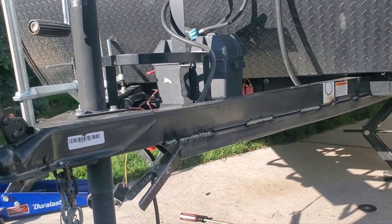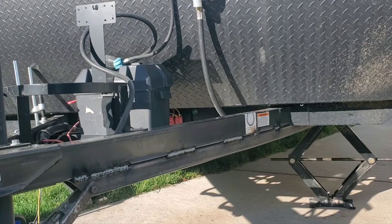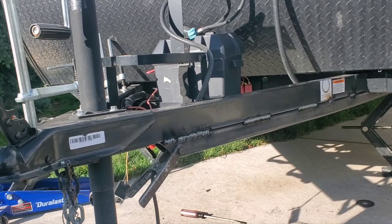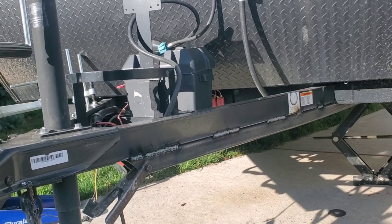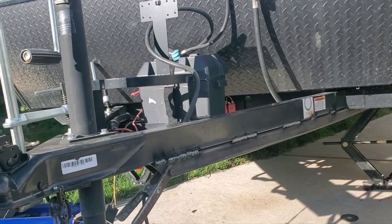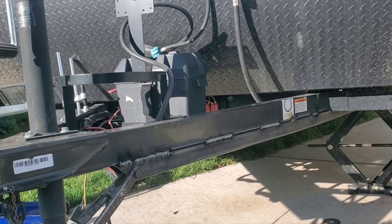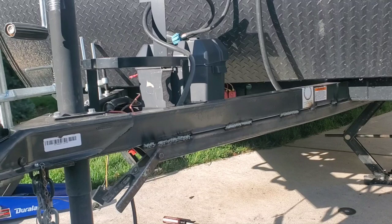I've been going over weights in my head. The front water tank sits right up in the driver's front corner — it's 20 gallons, so that's about 170 to 180 pounds — and this trailer is only rated for 561 pounds payload. A little Honda-type generator is probably just over a hundred, and a full cooler probably the same, and they're both behind the axle. That's roughly 400 pounds plus 150 in miscellaneous and luggage — I think this is a manufacturer defect, and it's pretty sucky.